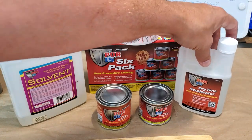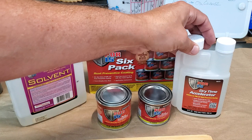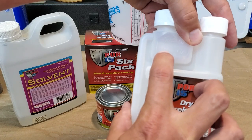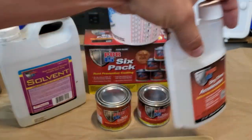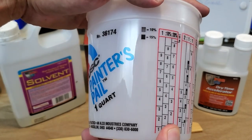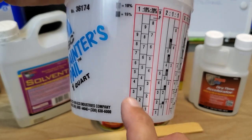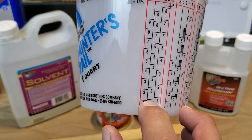The accelerator is really cool — it's one quarter ounce per quart of product. Eight ounces here is one quarter quart, so we need one quarter of our quart size. There's the one-quarter gradient — half and half again, so not a lot. I've already marked it on the back. So that's how much accelerator we're going to use. We also have a stir stick and, most importantly, one of these cool mixing cups. These come in different sizes and as you can see, here's our percentage scale — we're going to reduce it by 5%, which is half of the 10% mark. Whatever product we put in, it probably won't be enough, so I'll probably have to use a smaller cup. But you can see that if you put one serving size in, the next column is your 10% — so 5% would be half of that. Not a lot — you have to be careful.